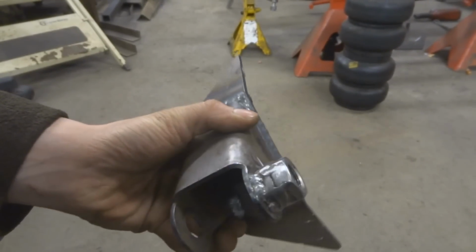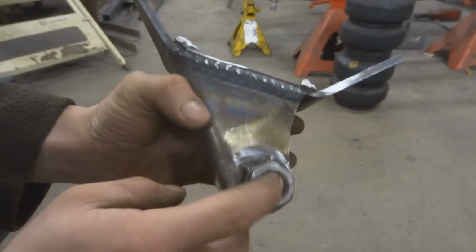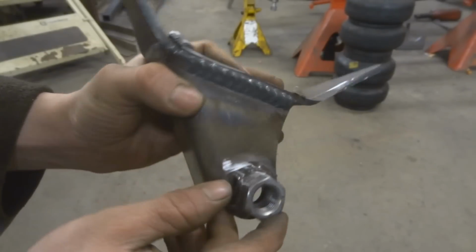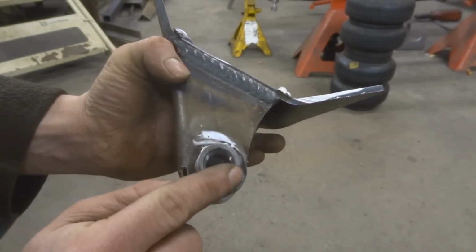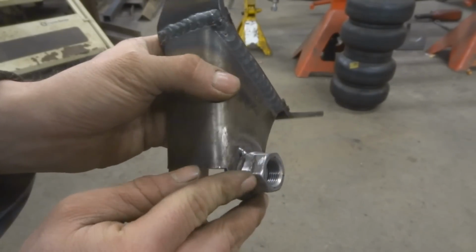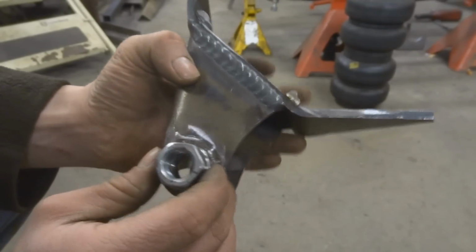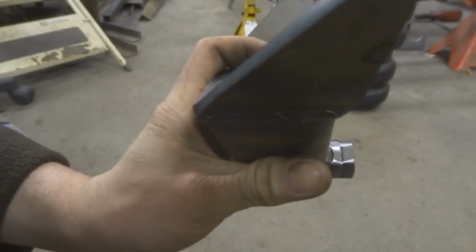Now if you look, you can see that I got these welded together and then welded onto this also. I made sure not to get too much heat so the threads didn't get messed up. And then I took it and I ground these down a little bit, these welds that are holding this together, so that it can fit in my hole. These are about 1 inch across. The nuts were about 1 inch across before I welded on them, but I intentionally made the hole 1/8 of an inch bigger with the hole saw so that I'd have a little bit of room extra for my welds here, so I didn't have to grind them all the way flat. Just create stronger welds. And this is all gonna be hidden, so it doesn't really matter what it looks like. Now I'll put this up on the frame into the hole and weld it up.